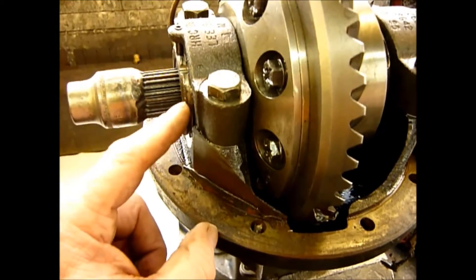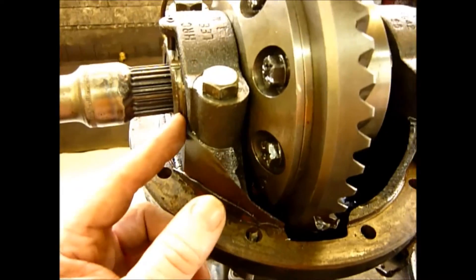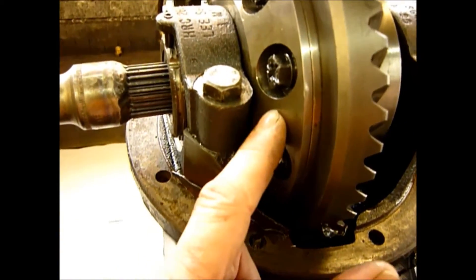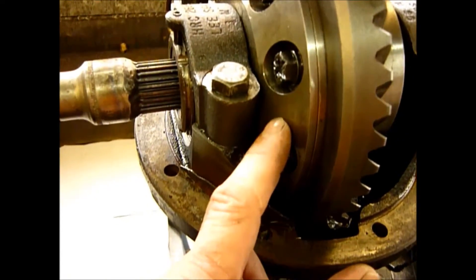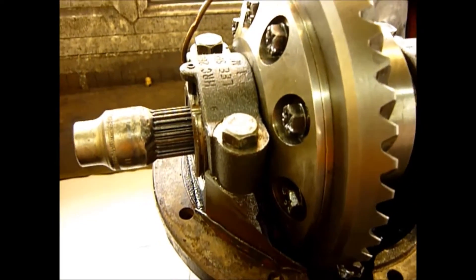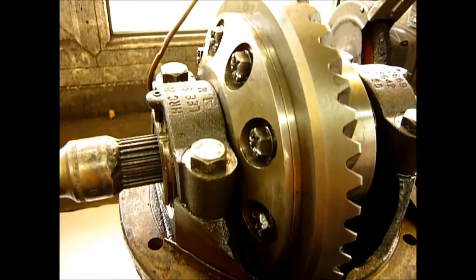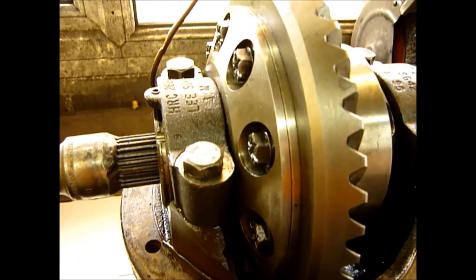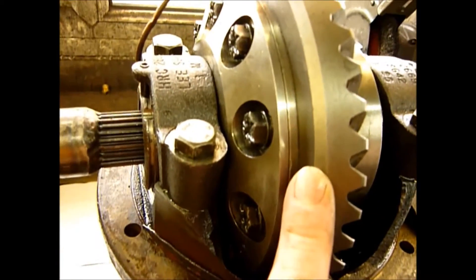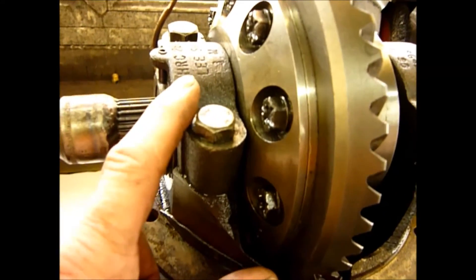What happens is the o-rings rubber groove into the flange, it then starts to leak air. You put a new pair of seals in and they don't seem to last very long before it starts leaking again, and that's because this flange here has had it. The only way to really fix that is to put a new end flange on, which are seriously expensive because there's quite a lot of machining in them. This is just one of those things — if you've got an ARB, whatever model, not even Land Rover, any model — ARB tends to be a problem because as we've shown in other videos, when this assembly is moving the o-rings inside here are being rubbed against things and therefore will wear.